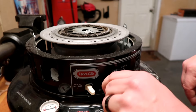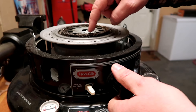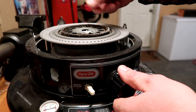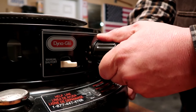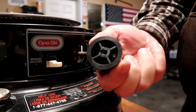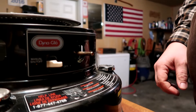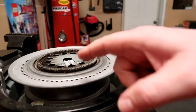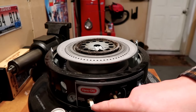That's the wick adjustment knob, and that's where the wick comes out at the top. As you can see, it's chock full of burnt paraffin from some of that alternative fuel I may or may not have used from the gas station. This adjustment knob has to come off first, then you take that lower housing off, which will expose the wick housing, the backfire ring, and all that good stuff.